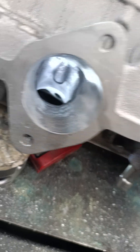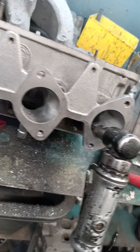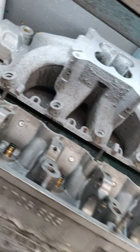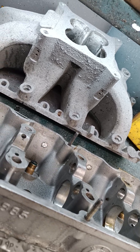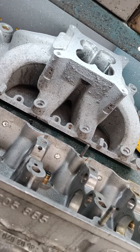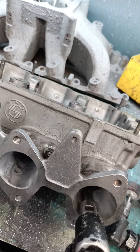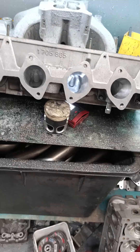So that's what we've got — a little bit of port work today. We've got to finish this head and manifold, and this goes on to a 2.8 with 45 mils, so this has got some Webers going on it. I've got a Ford Windsor intake manifold at the back here, a Parker Funnel Web — I've got to go through that. That's probably 10 or 15 hours of port work that it actually needs to work with the big heads I've got. Always got jobs on the messy bench — banshee barrels, pump housings and things like that.